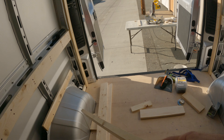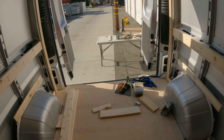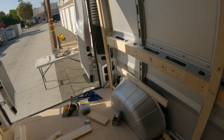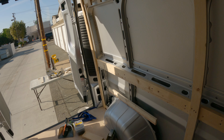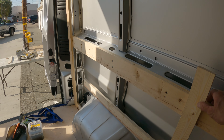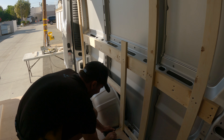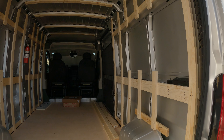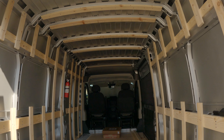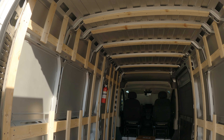I just added a piece here and here to build out, and now I just need a few more pieces going up. I know I need 32 inches of clearance under the bed to fit a mountain bike with the wheel off and the seat down, plus two and a half inches for the width of the two by three, plus half inch for the plywood top, plus about a quarter inch for the finished flooring — so I made this 35 and a quarter inches. I'm just going to add a few at that height going across on each side, and then the bed will come in like that. We're going to call that fully framed — that'll pretty much do it for this episode. Next episode I'm either going to be putting in the MaxxAir fans on the roof or starting on the wiring, and after that it will be the spray foam insulation. If you haven't already, please hit the like and subscribe button and I'll see you guys next time.